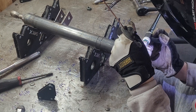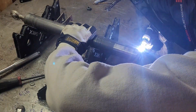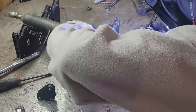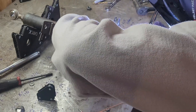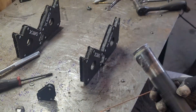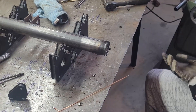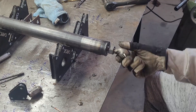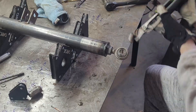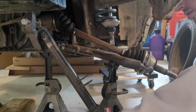This is my homemade heim joint system — it's essentially just a washer with the right nut welded on the backside. Close to the tube, I found I can keep the torch in one hand at the same angle and just rotate the whole assembly in the other hand. And yes, these are left-handed heim joints — I got a giant box of them very cheap because they were left-handed.